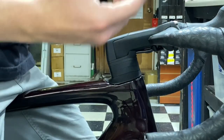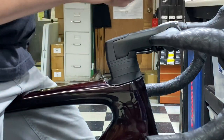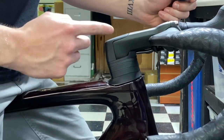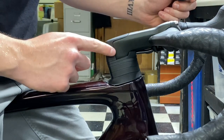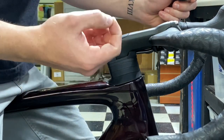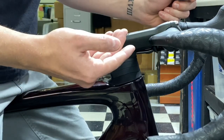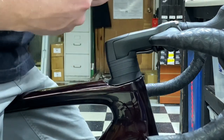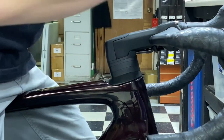You'll probably need one to two spacers depending on how low you want to go. The idea is that you can lower your stem, ride it for a bit, and then decide if you want to cut it. You might lower it too much and feel uncomfortable, then want to go back up — so instead of committing to a cut on a fully integrated bike, you have the option to adjust it.